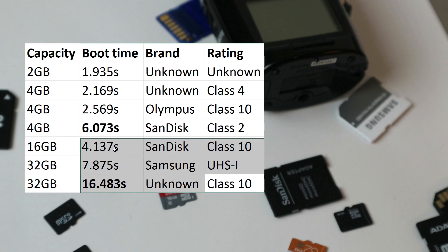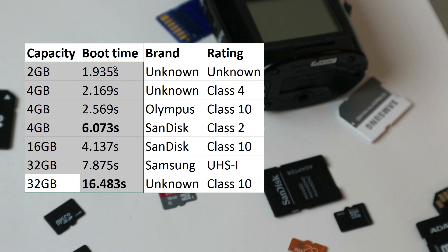So what does this mean to you? It means you should test your own cards. If you have a 16 and an 8 gigabyte card, test and measure how long it takes them to boot. If you have two different 16 gigabyte SD cards, compare them — one might perform much better. In extreme situations where you're hunting for sounds that really need to be recorded, you should switch to smaller cards. At least now you know what's going on with your recorder and why it's taking so long.